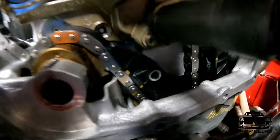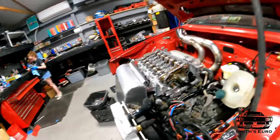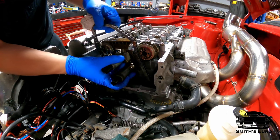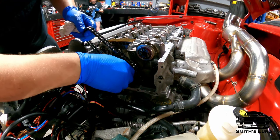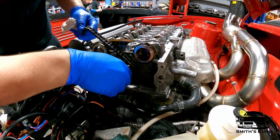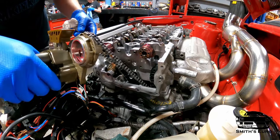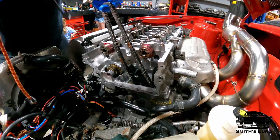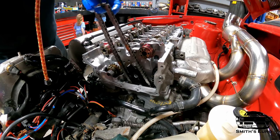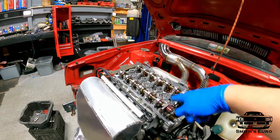I had to pull the lower bolt on this timing guide so it'll slide out of the way. I have just enough clearance that the cam bridge should slide off — obviously try not to have it fall down. The timing chain will fall down, but you want to keep tension on it so the links and everything match up. It's up there, it's all safe, and we can start running the caps off.